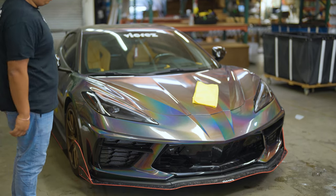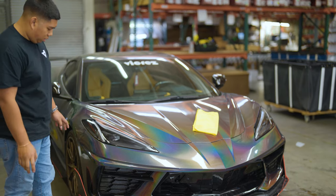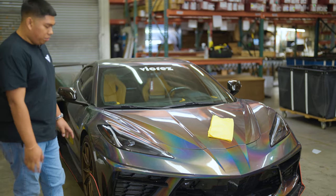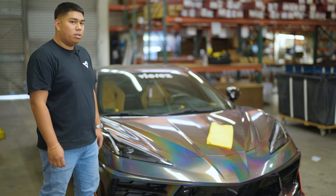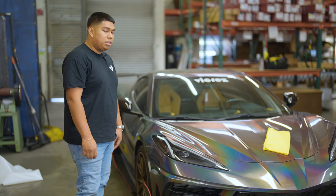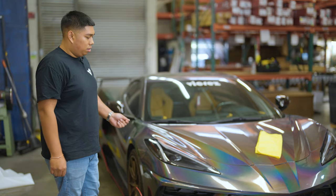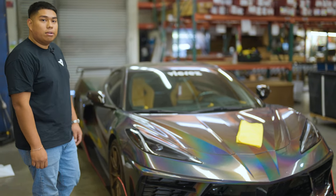So we've completed the install on the pre-cut kit for the C8 Corvette. This is after doing your necessary trimming and heating on all your edges. If you do have any leftover moisture or water bubbles and it's very minimal, give it 24 to 48 hours to set overnight — almost always it'll evaporate. But in the case that it doesn't, then you just go ahead and grab a syringe, poke the water and extract all the excess. But yeah, that's pretty much it for the C8 Corvette bumper.